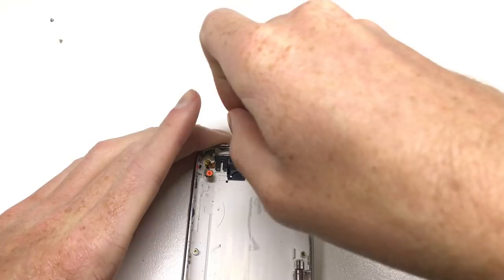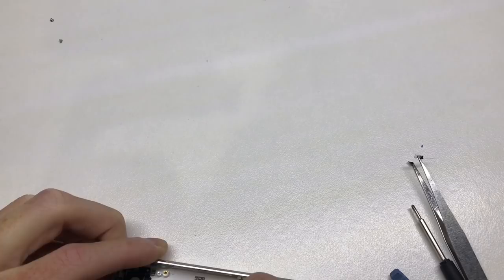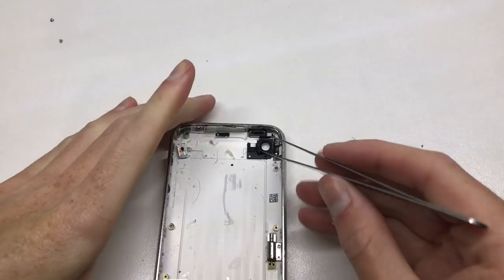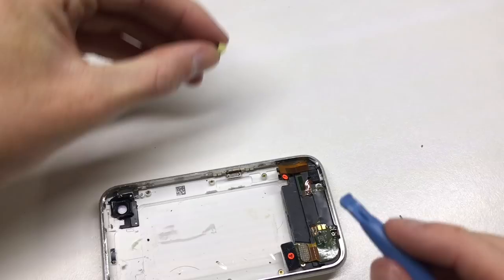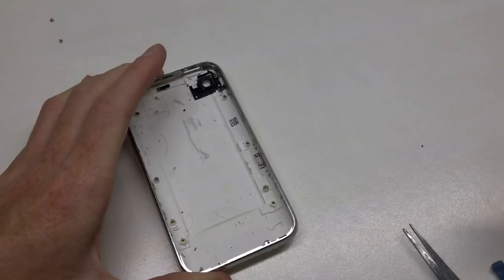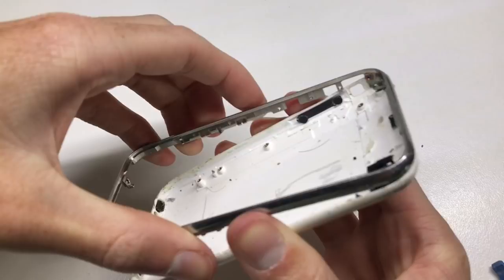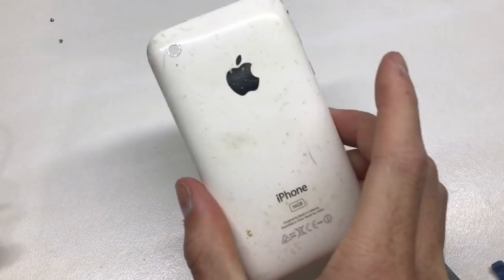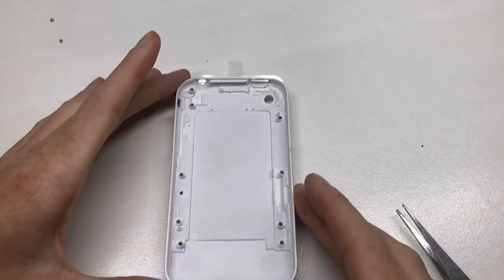The hardest part of this repair — and any iPhone repair — is the volume controls, mute switch, and power button assembly. The power button on the 3GS is relatively easy, but the volume controls and mute switch were quite difficult. I had to get the mute switch properly aligned with the internal switch so the external switch you flick actually works. If they're not aligned, it just moves around but won't change the mute. The volume controls also seem a bit stiff, likely because the housing from China for 12 bucks isn't the most precise.